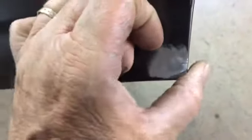Not terrible. We polished our corners a little bit. They don't look bad at all. There's one little spot here. Must have got the corner of the dolly. It's not bad. There's a couple of little wrinkles here and there, but it's not bad at all. I'm good with it. Another little low spot right there. Probably just from not keeping the dolly flat when I was hammering on that other side. So polished up this corner here a little bit, and we'll tweak it and make it look better. But again, it's much better than it was. A whole heap. Glad we did it now, but we wasn't glad when we were swinging that hammer.